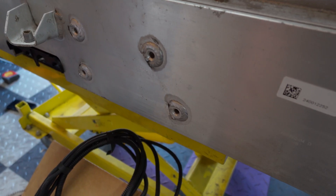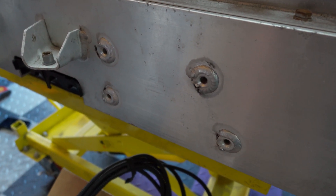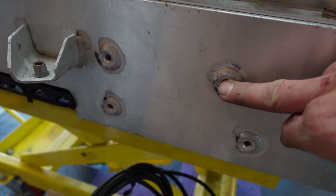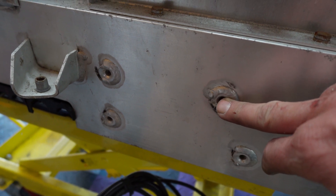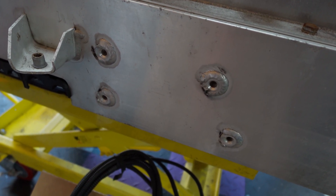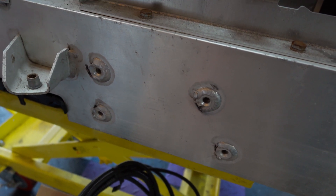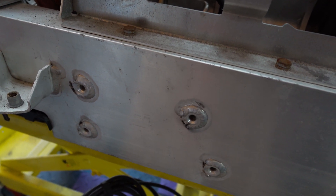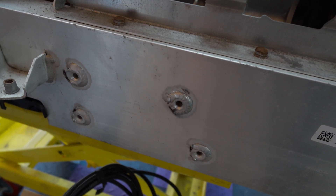For what's now the rear motor mount, we came up with a system similar to what BMW did on the front motor mount, providing a nice rigid mounting point that's not going to collapse the aluminum frame rail. We're replicating what BMW did in the factory by having aluminum sleeves that go all the way through the subframe and prevent the tube from being crushed. Since I didn't really want to weld to the subframe, I have an aluminum plate that we'll weld our spacers into, which will then go against the subframe and bolt everything together on top.